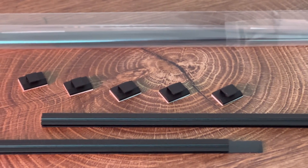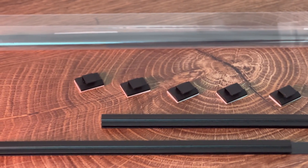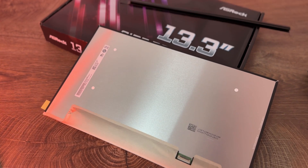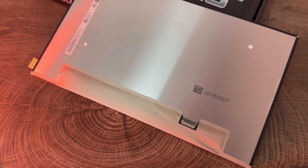If you're worried about the tempered glass and the brackets leaving stains, they actually added some sort of a removable double-sided tape on the sides. So if you decide to remove the side panel, you just shut down your PC, remove the tempered glass, disconnect the EDP cable from the panel, slide out the additional screen, and remove these plastic tips — that's it. There are no stains on the tempered glass; you can just clean it after that.